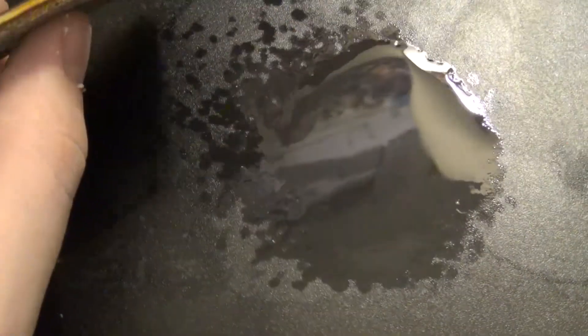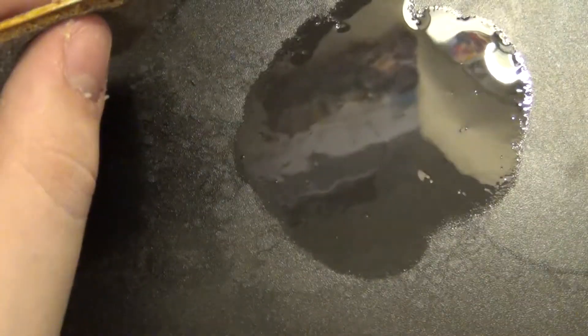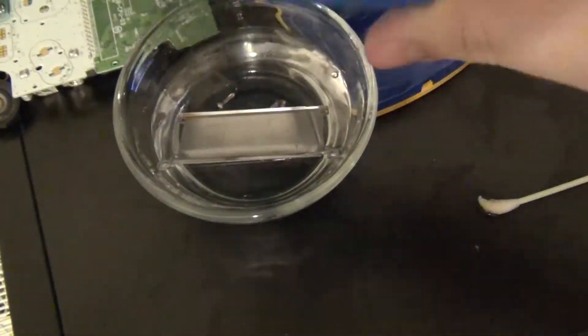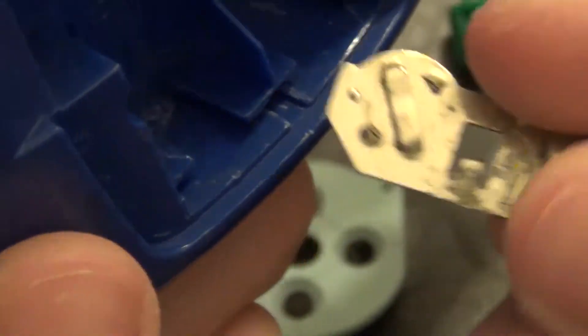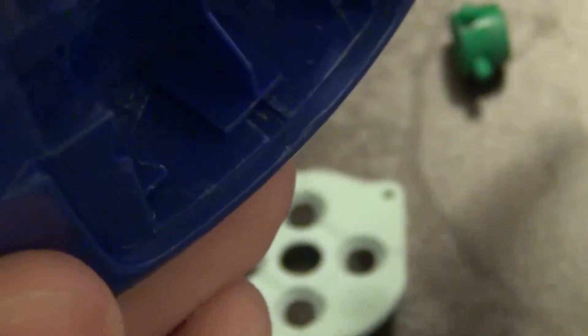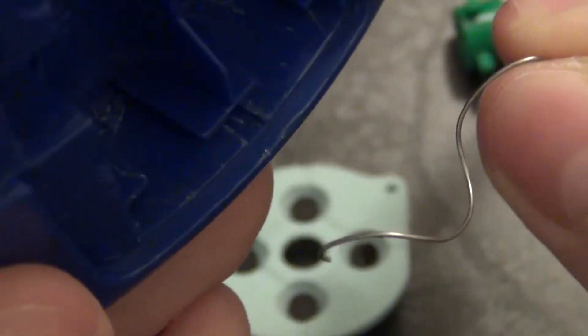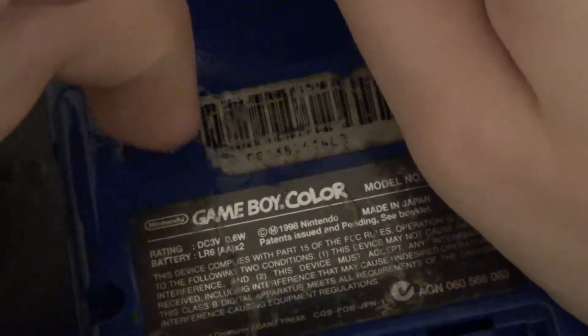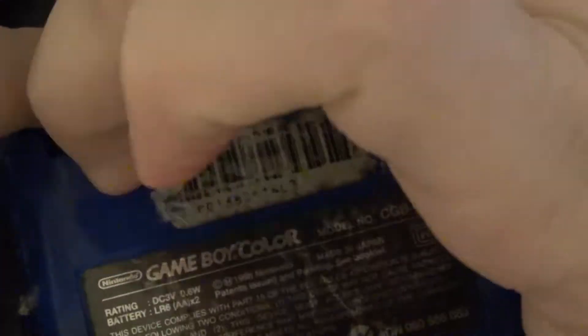There's some rust on the sides of the screen, including on the foam on the back. I was able to get that off, except for the part on the foam. I soaked the RF shielding and the screws in vinegar and let them sit overnight for about six hours. I also damaged the battery terminal — unfortunately I was not able to remove it successfully in prep for cleaning. I cleaned the shell off camera and was able to get most of that grime off the back, although the bit of the geometry sticker had to go. I put some IPA on the original stickers to remove them and place new stickers. The serial number sticker didn't come off easily so I just scratched that off, but the Nintendo sticker came off easily.